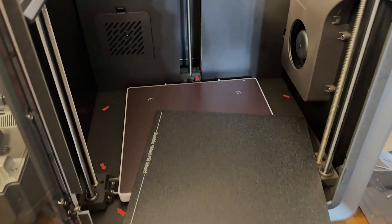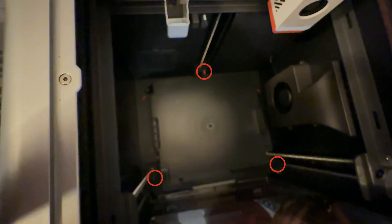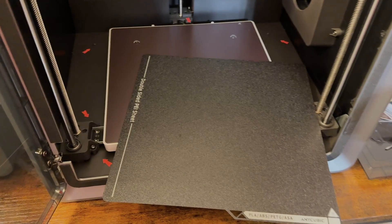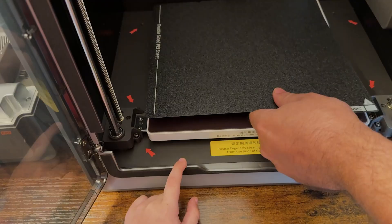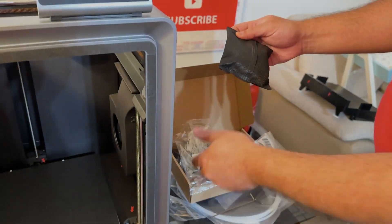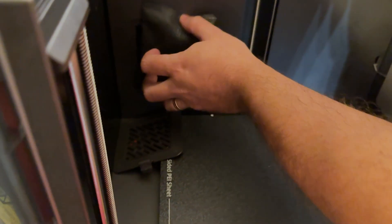While we're at it, let's also release the printer bed. It's secured to the bottom of the printer to protect it during transport. We remove this fixing by removing 3 screws, also marked with red arrows. So during installation, we remove all the screws marked with red arrows. While we're here, I open the filter box and replace the activated carbon filter. This will filter the exhaust gases from the printer.